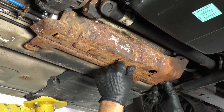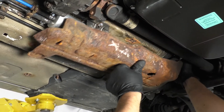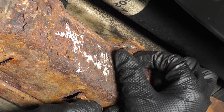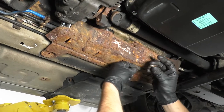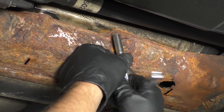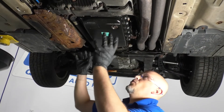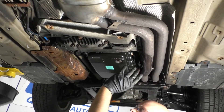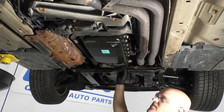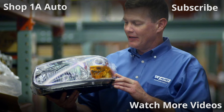Get the cover lined up here. This cover's pretty bad — it would be a good idea to replace it, but we're just going to reuse it. Put the bolts in, and there are two nuts that go over here. Take an eight millimeter socket, extension, and ratchet to snug these up. At this point, if you have the underbody cover that goes right here, you're going to want to put that on and secure those fasteners in the correct locations. This vehicle does not have it, but it's a good idea. Thanks for watching. Visit 1AAuto.com for quality auto parts shipped to your door — the place for DIY auto repair. If you enjoyed this video, please click the subscribe button.